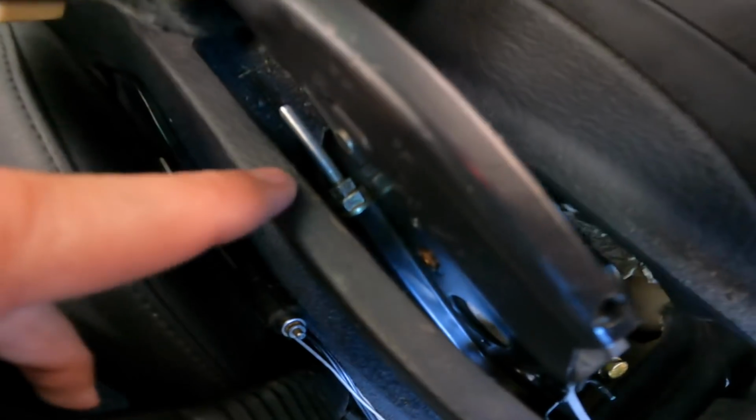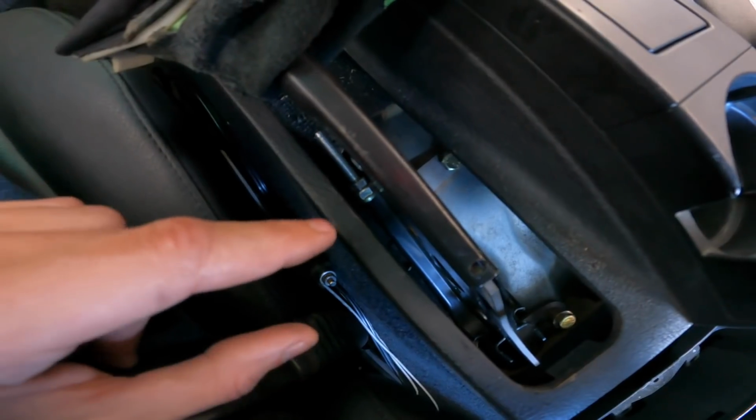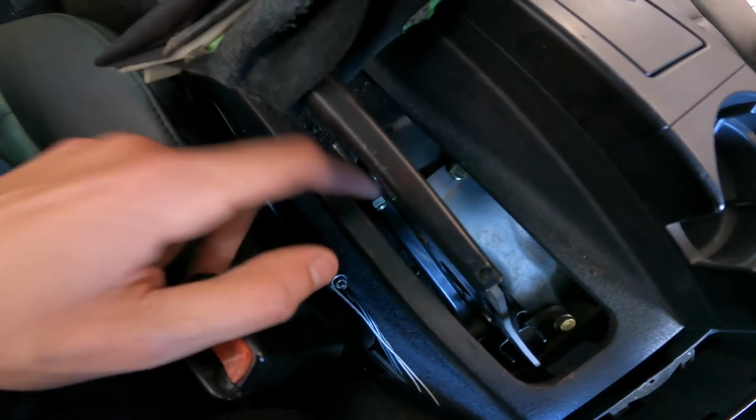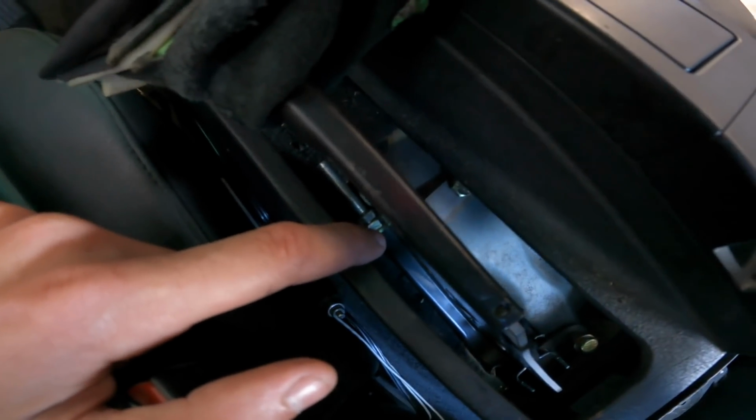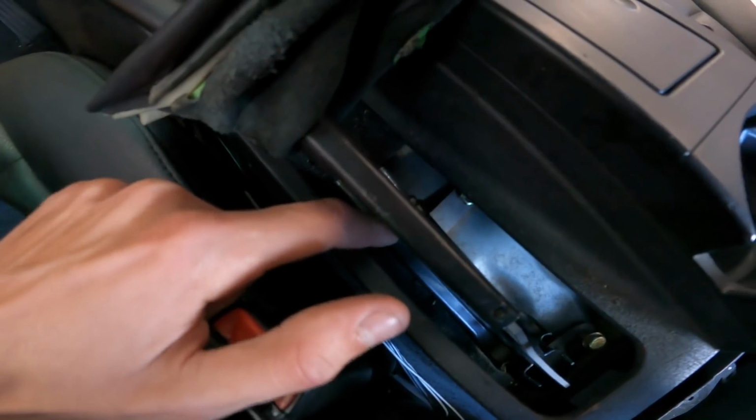First thing you're gonna wanna do is tighten these guys up. So really all I do is do a couple more turns than snug. So I'll just finger tighten them first and then a couple turns after that. Those nuts are 12mm, and then there's a 9mm nut that goes on after, just so it can't back off.